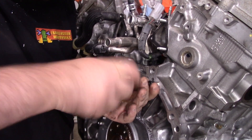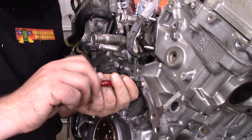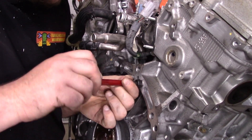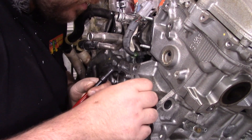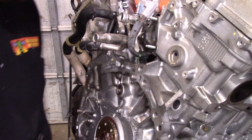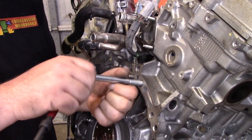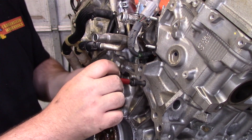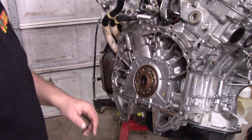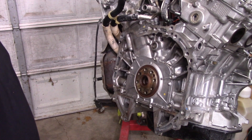Let's get an insert in there. By the way, this is just the off-brand recoil. The helicoil ones have a much nicer starting tool, especially if you haven't done this a bunch — I'd suggest the actual proper helicoil tool. Now grab an M12 bolt and check to make sure it fits. It bolted nicely, which means you've got one last thing to do: there's a tang at the bottom that you used to install it — you need to break it. Next, clean all the chips, and with that step done, we need to worry about the transmission actually bolting onto this engine.